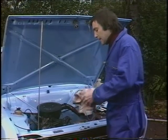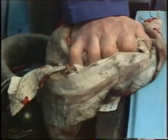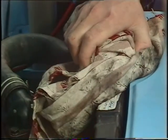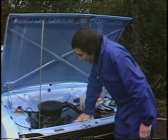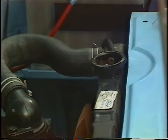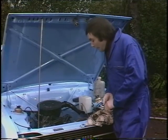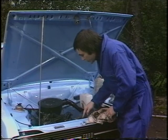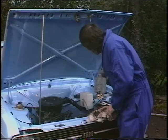This is the right way of doing it: you get a nice thick old bit of rag, place it over the top, and turn it to the first notch — you may just be able to hear the pressure coming out. Then very, very slowly and carefully take the whole thing off, because remember, water-cooled systems run under pressure. The coolant should come to about an inch below the neck of the filler. In fact this one doesn't, so we're going to have to top it up.